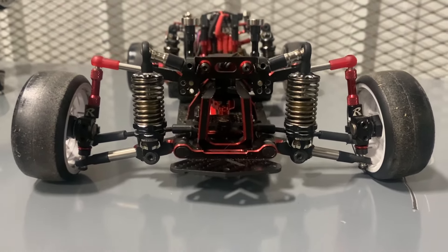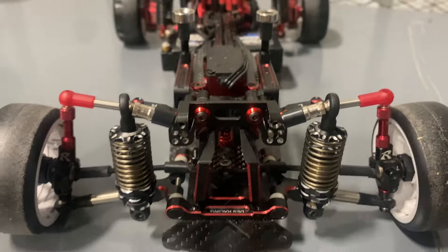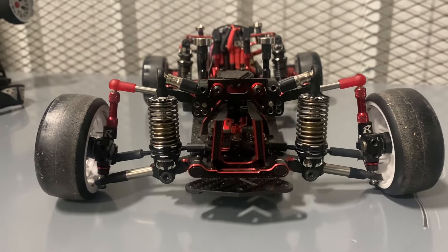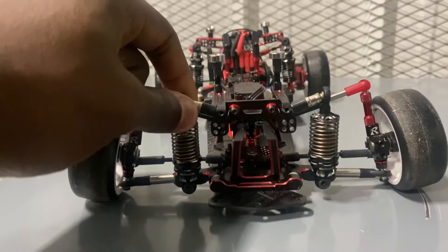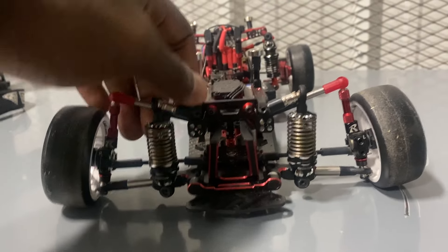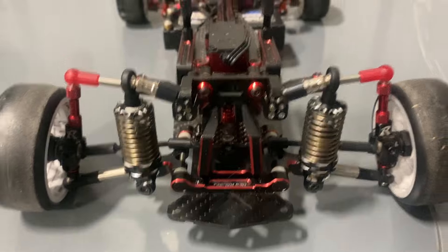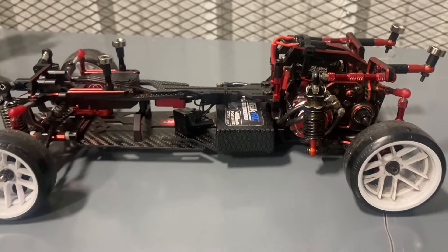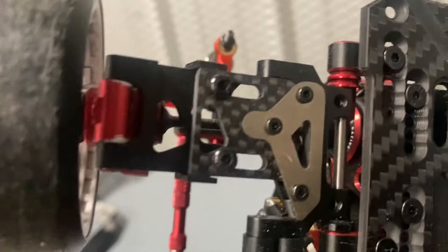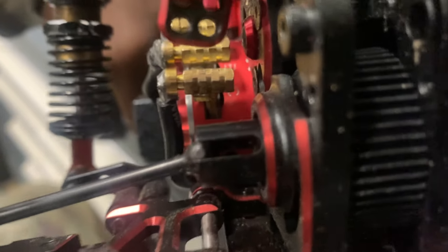I would have opted for IFS, but I didn't like where it was placed and it didn't perform well in my opinion. The Unicon also has an updated conversion kit that gets rid of the cantilever suspension, but I didn't buy that one. I bought this one and made my own front and rear suspension setup. The adjustable arms in the rear are all the way out, which is why I had to get these axles in the first place. When it's fully drooped, I'm barely in there.